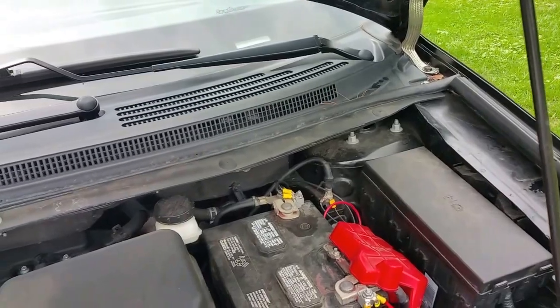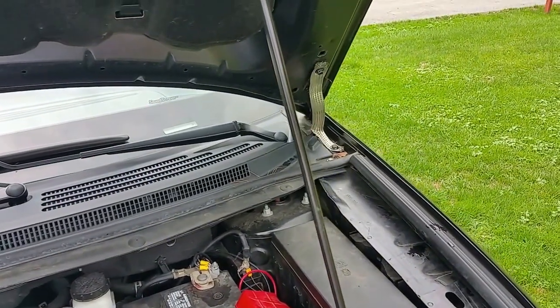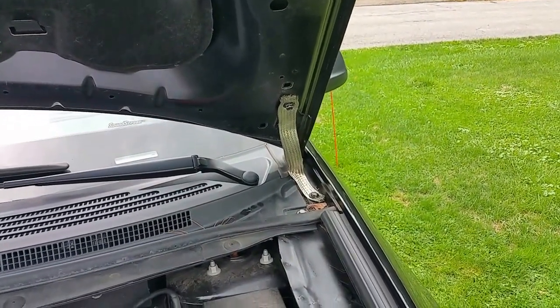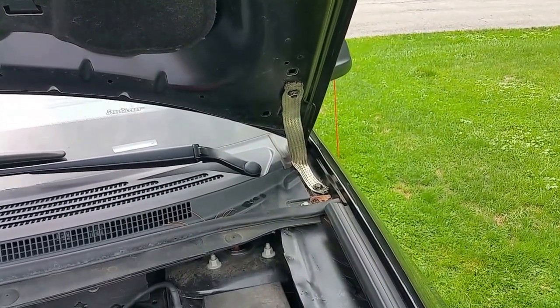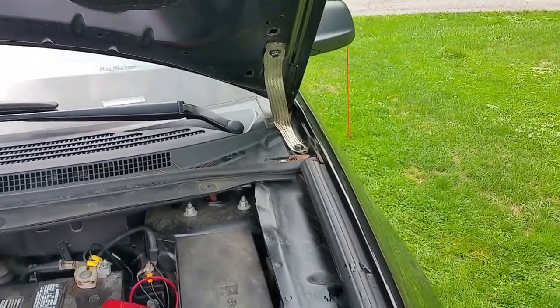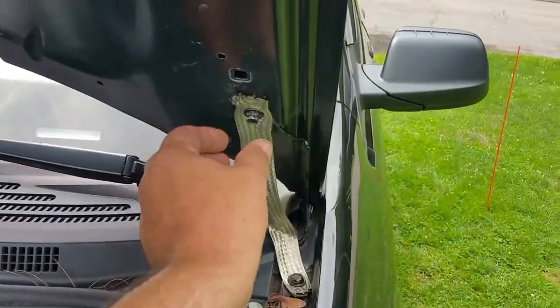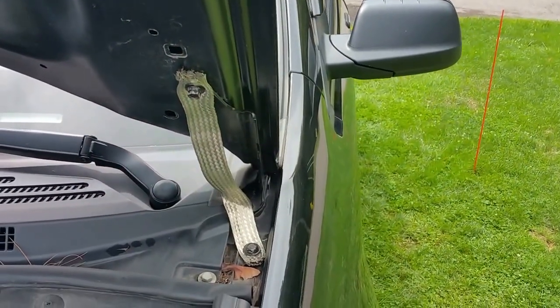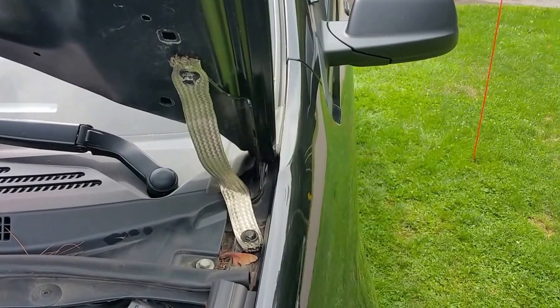All my connections are all to the battery. I did have a problem originally where I didn't have any bonding and I couldn't get it to work on a couple of the top bands. After I did all this, it all works — thanks to the people over at Tar Heel for the information. This stuff you can get on eBay — it was $18 for 10 feet — but they do recommend one inch bonding straps.